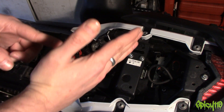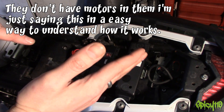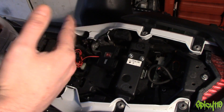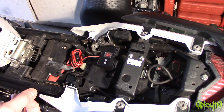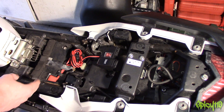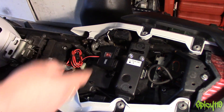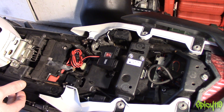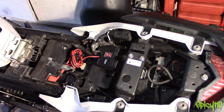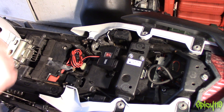What you can use to stop that happening is something called an automotive relay — basically a switch within a switch. Imagine a high-power line on one side, and a small motor using a tiny amount of power to click that switch on and off. With an automotive relay, you'd have the power going to one side, a cable to the other side giving you your link, and that's switched by wiring the relay's control side to something like a tail light. When the tail light has power, the relay switches the charger on; when you turn the bike off, it turns off.